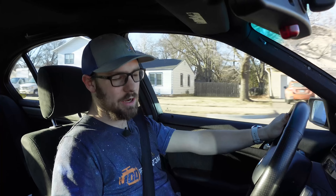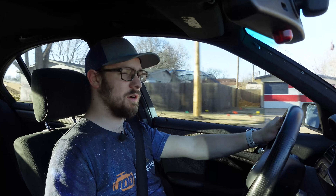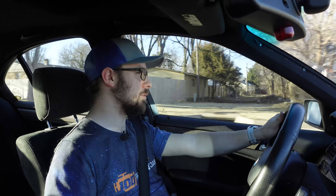The lumps in my power delivery are gone. At 2,500, about 3,200, 4,000, and every 200 RPM past that, I would get this sort of lurching power delivery. I'm guessing that would be the computer trying to compensate for the bad readings it was getting from the mass airflow sensor. We're down to 3.1% long-term fuel trim on bank one and an 8.6% trim on bank two. It's not where I'd love to be, but it's okay. It'll get me around town. It's smooth at least, and reliable — just not optimal.